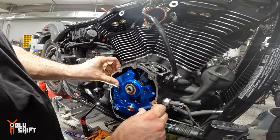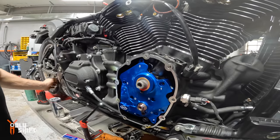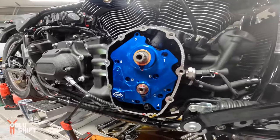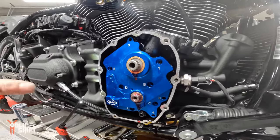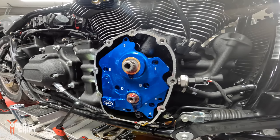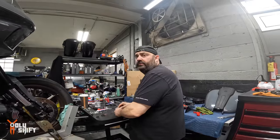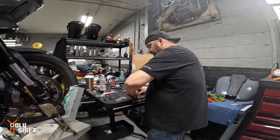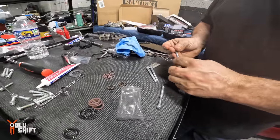Okay. There you go. Yeah, easy. One, two, three, four. And then A, B, C, D. But you've got to turn the engine over twice before tightening the ABCD. So what I do is run the bolts in, 5 foot-pounds, turn the motor over, another 5 foot-pounds for your total torque of 10. It's either 10 foot-pounds or 120 inch-pounds, same.